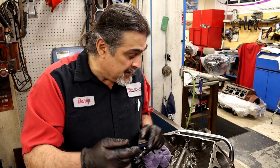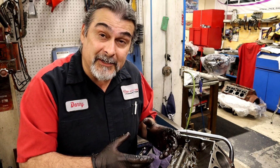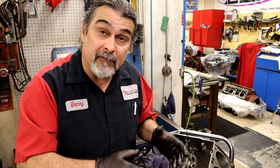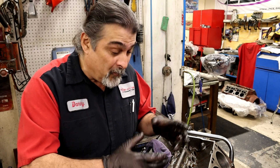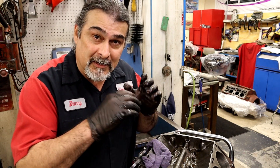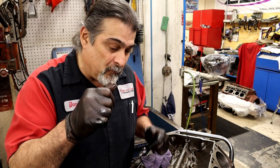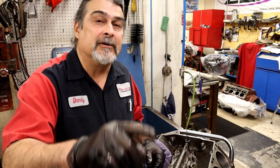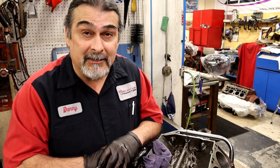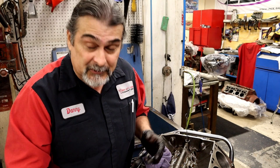If you're at home doing this, buy a set of brushes on eBay and do this yourself just before final assembly. When you have the engine on a stand and you're going to wash everything, physically run a brush through every hole. Hit it with hot water and hot soap and then start assembling. It will never ever bite you in the butt. Don't overlook a simple process.